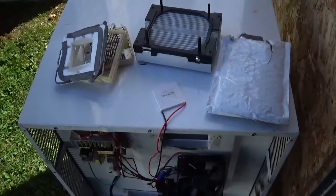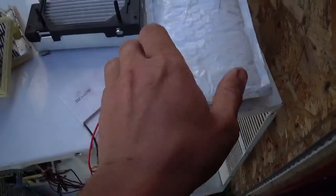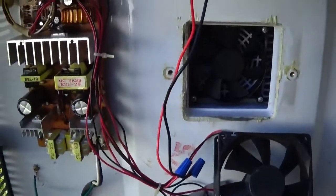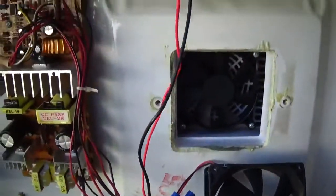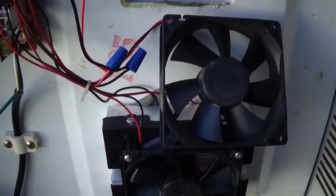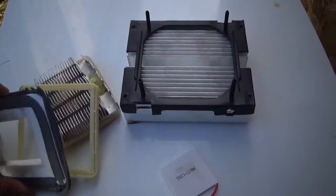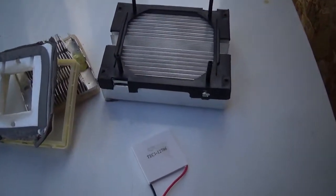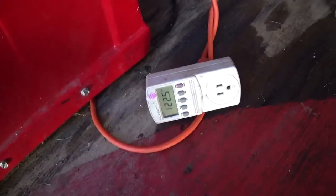It's been about a week and I've got the new peltier devices. I got five of them, only got one laying out here, and they came individually wrapped. I'm not going to sell this machine — I'm just going to probably take it to work — so I'll just use wire nuts. I could get all pretty and solder them directly to the board, but it'll work just fine this way. Pretty much this just gets sandwiched between the two heat sinks with an insulating barrier. I'd like to note that with one peltier missing, this fridge draws 70 watts.